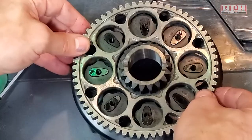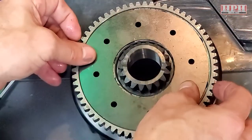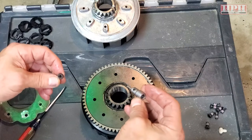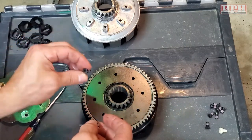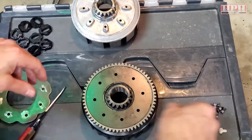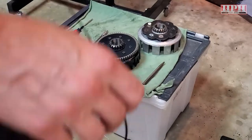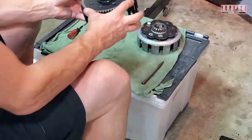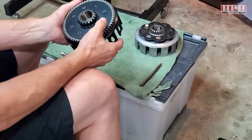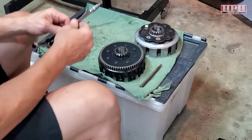You'll take this and press it down on there. It comes with its own little plate as well. It also comes with its own fasteners — the Wiseco kit even comes with its own wrench, a little Allen socket and everything. The fasteners already come with red Loctite on them, so make sure you Loctite the new fasteners and then cross-tighten to secure the kickstarter gear onto your aftermarket clutch. The only thing left to do is tighten these down to 80 inch-pounds in a crisscross pattern.